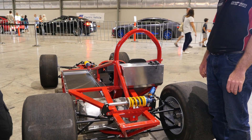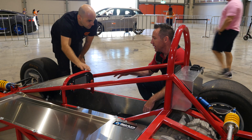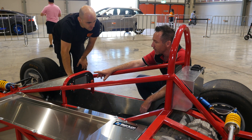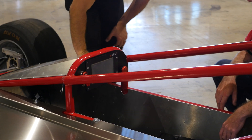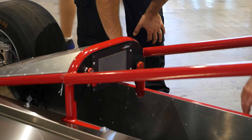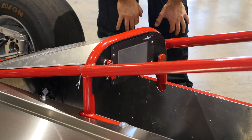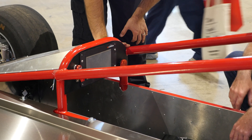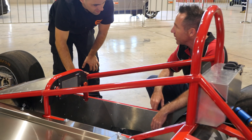We only get about three months, if that, depending on how many runs. So basically this is the EV control unit that we got from EV West. And basically this controls all of the parameters and settings in the Tesla motor. They've gone to the effort to actually have a plug-and-play scenario where this plugs directly into the inverter - one cable into the inverter, one plug into the back of this. A wire to your throttle, put your two power wires in and away you go. Happy days. You can control all the parameters from inside that - it literally is just your touchscreen slide and play.